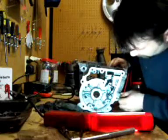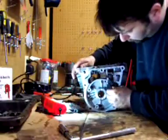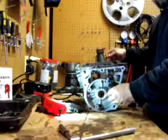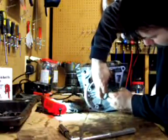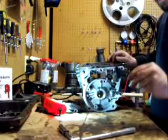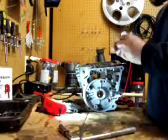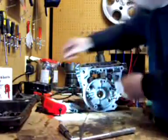There really isn't much left on this casing except for the parking pawl right here. Go ahead and remove that spring — there's the parking pawl. It doesn't look to be damaged. There's the pin.